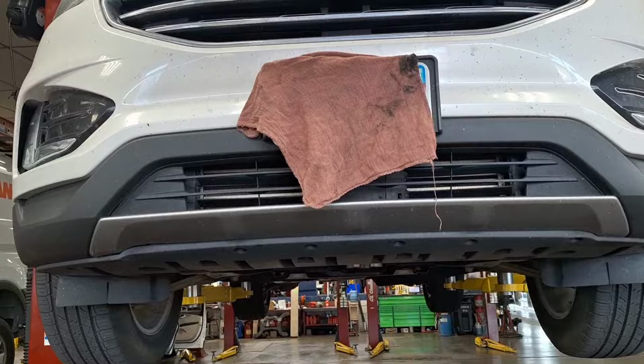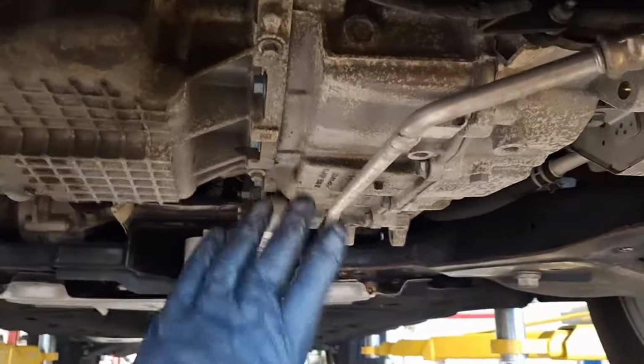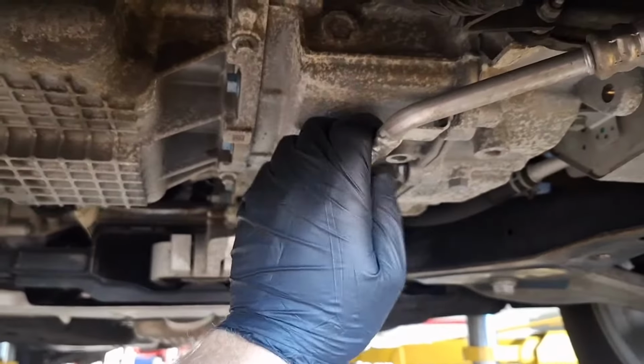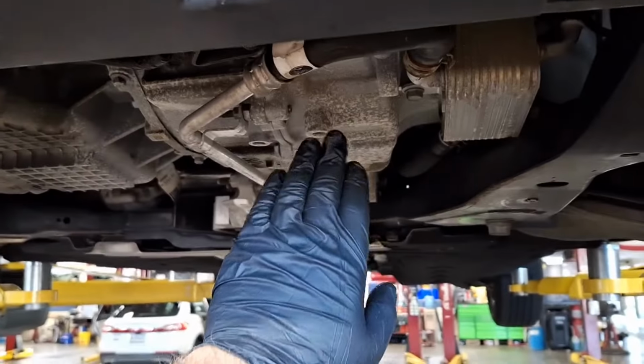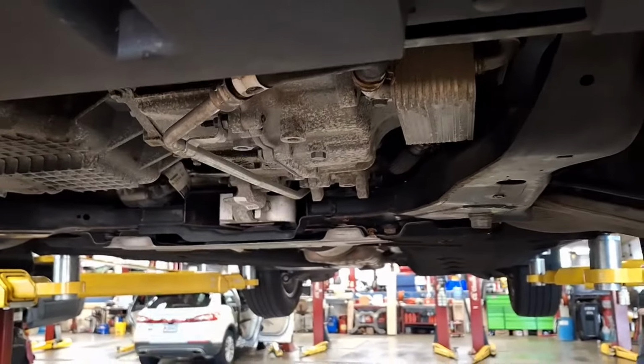So I think that being that these 8 speeds and 6 speeds are very hard on fluid, the fluid is just really broken down and has gummed up shift solenoids and the torque converter clutch. Let's see if I can resurrect this thing. I like to run 2 different cleaners through it, drain and fill it 5 or 6 times, clear adaptive tables, drive it, and just see what it does.